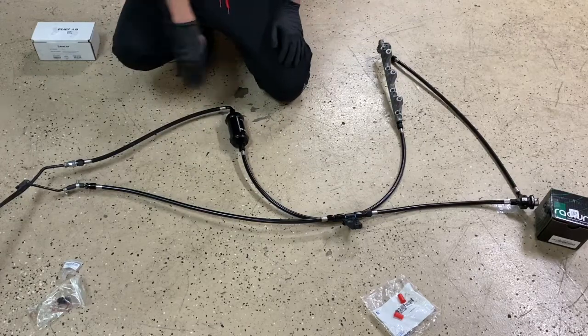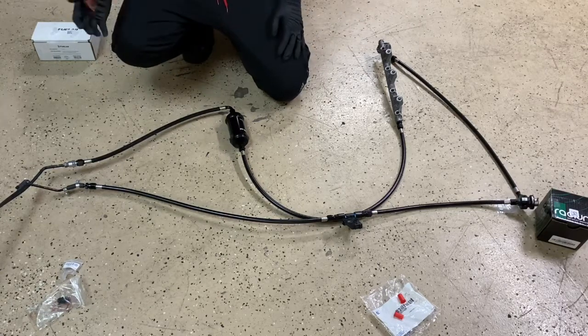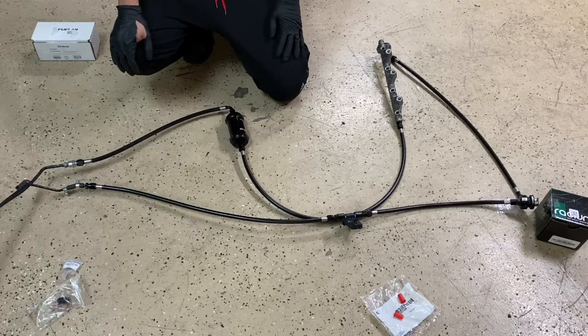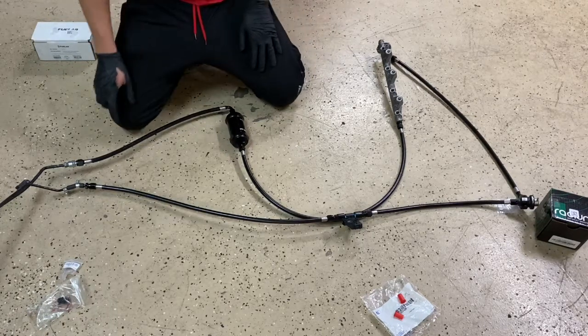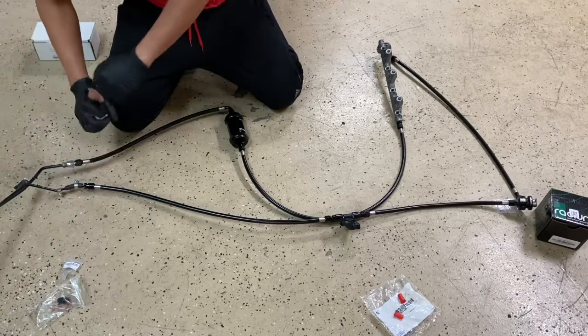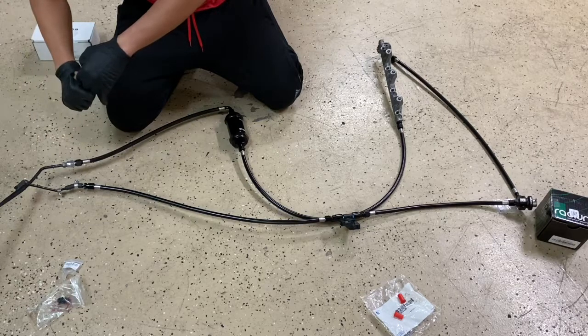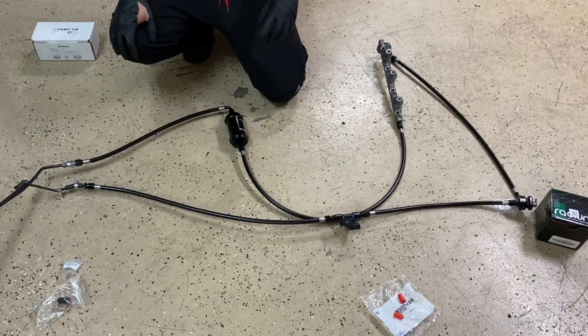You can put gasoline or E85, and this is the solid way I run on my car. If your gas tank is out of the car, you can redo this line to an actual dash 6 — you can buy a quarter-inch slip-on with a dash 6 attached to it. But yeah, this is how you do an E85 setup on your MR2.